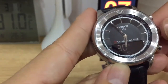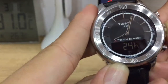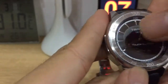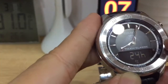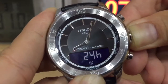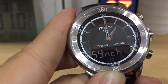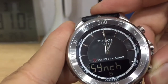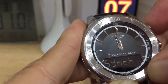So how to reset it? You have to go to Options, enter Option, and then you see the setting for 24 hours or 12 hours. As you cycle through, go back to 24 or 12 hours, then hold the T button. When it says 'Sync Hand', use the plus and minus buttons to move the hands to show exactly 12 o'clock.